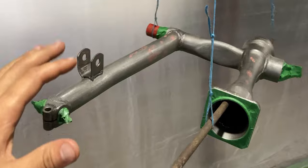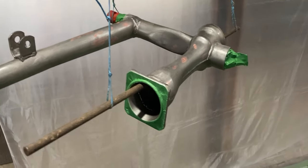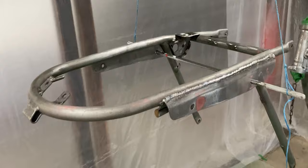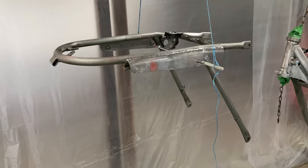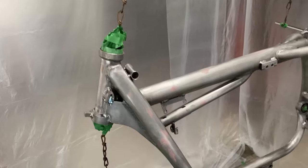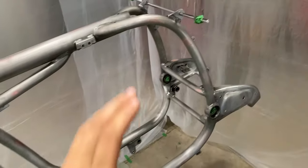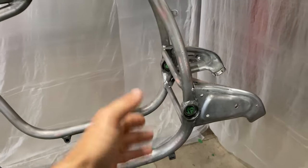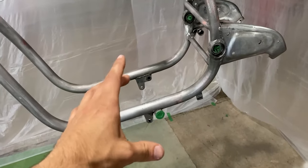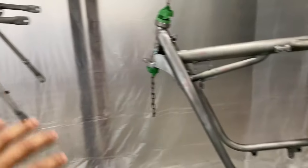Everything in this paint booth has been taped off and wiped down, ready for a coat of primer. Here's a close-up on all the parts: the swing arm has been touched up and everything has been masked off — especially a gasket surface and the locations for the swing arm bearings. The rear frame assembly has nothing to mask off because everything can just be painted. On the main frame I masked off the steering lock, the taper bearing areas top and bottom, some bigger threads I can't recut, and the foot peg areas.